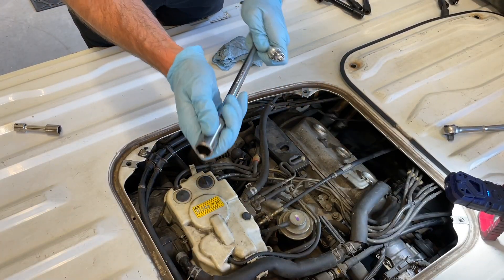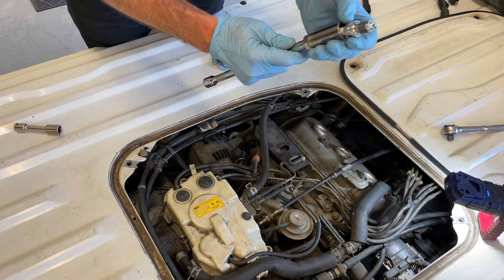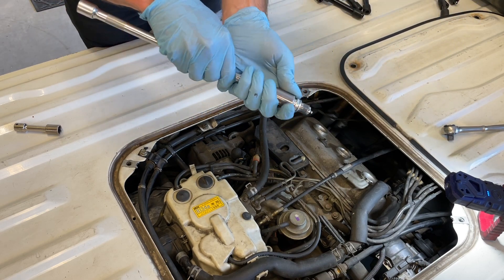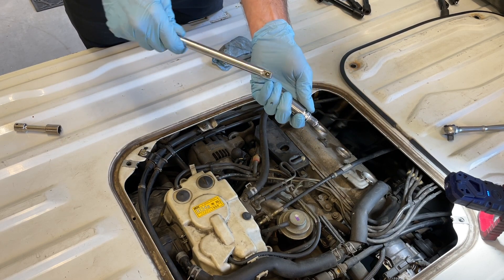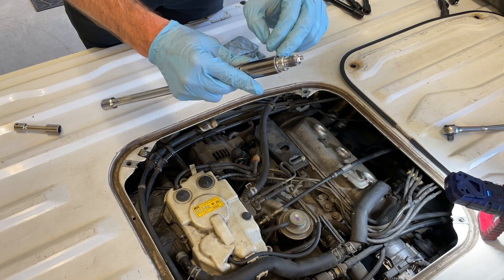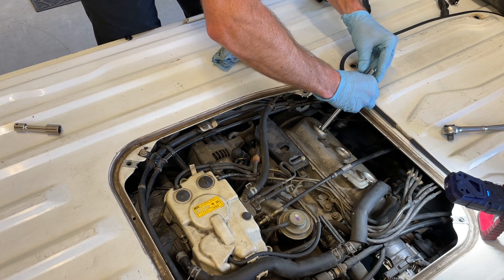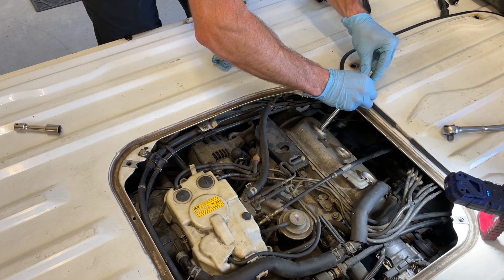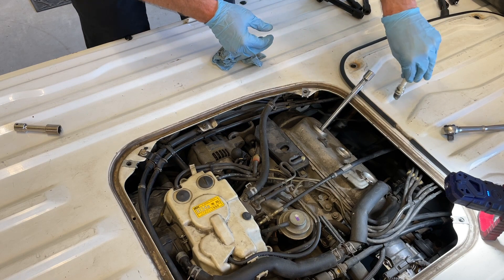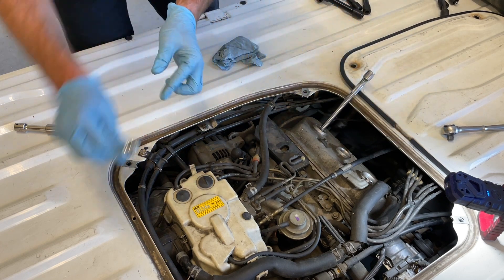A little trick of the trade I like to do: most of your standard socket sets come with a spark plug socket — it's basically got a piece of rubber in there that holds the top portion of your spark plug. Pro tip: don't press your spark plug jam tight in there. Reason being, whenever you get that tight in there and you go to pull out your extension, this is what happens to me about 99% of the time. So what I'll do is I'll just put the spark plug in the socket just until I get good engagement of the actual hexagonal portion. Then we'll just be real gentle going back into the cylinder head there, getting those started. Also, as you go back in here, if you remember earlier we gapped the spark plugs appropriately — the more you bang around, the more your gap's going to change. So as you're going back in, make sure you're staying just on the sides and you're not hitting the end of your electrode on your spark plug.